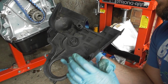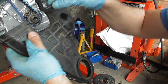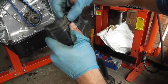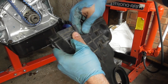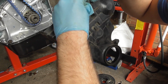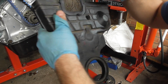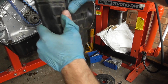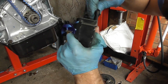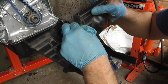Lower cam cover, I've put the seal around here, around the perimeter. I have one more here that needs to go on. That's just a simple matter of it's split in the centre there, and just push it on. It's got a longer side on the left and a shorter side on the right. And what you see, it has these little nodules in there, and they just hook over when you're in. Like that. So just push that in so it's in all the way.